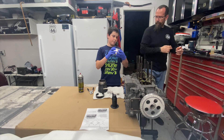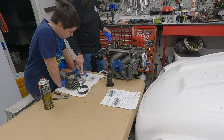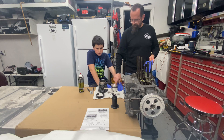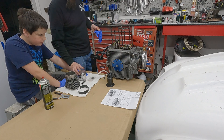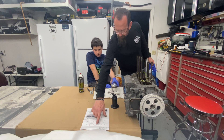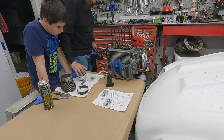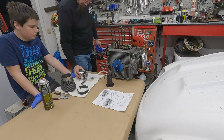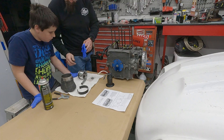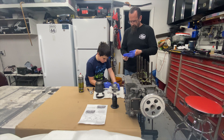Like those ring gaps? Now, looking at the top of your piston — remember, this is always going to point to your front. And since this is number three, your intake ring is the top ring — this is the intake compression ring, it's going to point there. Your lower ring is going to point there. Then you've got to set up your oil ring as well — your oil ring is probably already near the top, just get it set top and center.